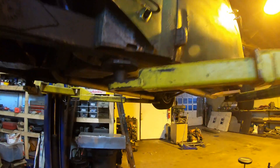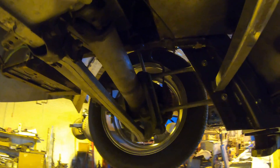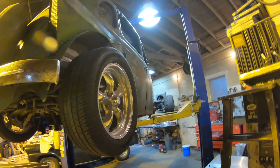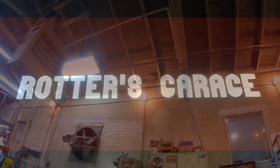I never really showed you guys the rear suspension - there are a couple things to address. It's installed fairly nicely but some things like the shocks - up here it's just angle iron which is fine, but it'd be nice to brace that a little. On this side they had the angle iron a little further back and we are rubbing on the drive shaft with the shock, which has a big dinger in it. We might end up doing a little bit of work on this rear suspension. With that being said, we'll come back in part two, get everything else done, take it for a quick drive, and get it back home. Thanks for watching!